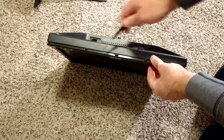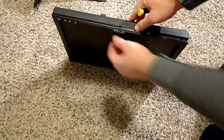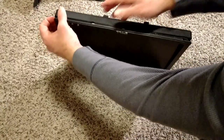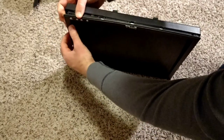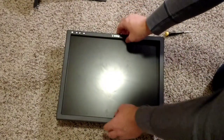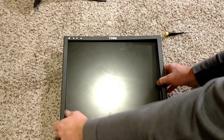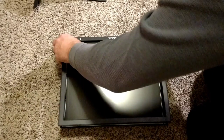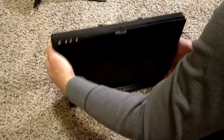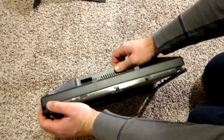Just keep going around the edge of the frame. You can see there were notches here, here, here, and here — then you can get a screwdriver under it to start popping the frame out and just start pulling around. Be a little careful with this side here because you've got your controls, and there's a ribbon cable connecting the controls, so work around it carefully.